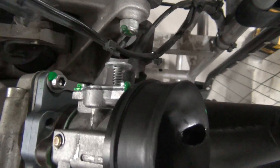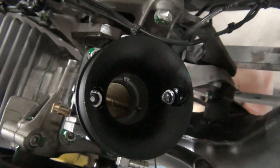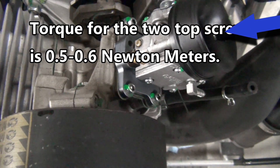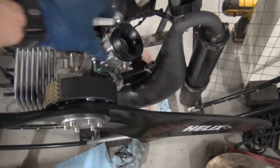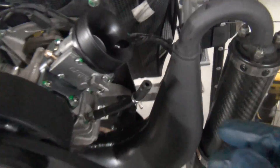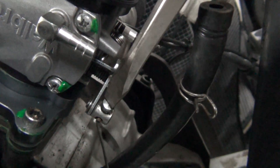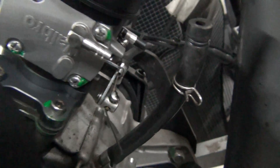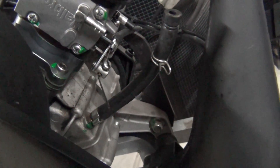When you look down at the paramotor, you can see all the different green torque paint spots. Everything's torqued down nice. These I can't see because the air box is on, so I use just a little bit of thread locker. This is steel into aluminum, so it's nice to have some kind of barrier between them — thread locker is a great idea in my opinion. You could also wiggle the carburetor to see if it's getting loose. By way of connection, you've got your cable for your throttle — it has a little brass tube on the line so it doesn't puncture through it. Do not over-tighten this; it'll basically work like a cutting device if you do. If it's too loose, you're going to lose your throttle cable and that could really mess up your takeoff.